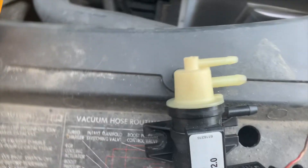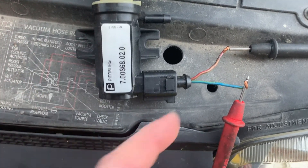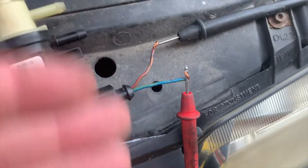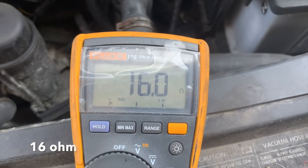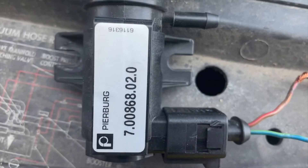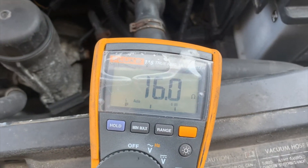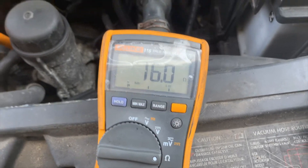If you want to test your N75, I'll show you how to ohm out the N75 valve itself. I'm going to grab a spare I have off the bench. This is a new one I bought when I was having an issue on my other car — I have a pigtail from it which makes this a little easier, but if you don't have one it's not a problem, you can just touch the pins inside. Hook them up — doesn't matter which side goes to which — come over to your meter, switch it to ohms. My meter is auto-ranging. That reading is from a known good new N75 with that part number for BEW. ALH might be slightly different, I'm not sure, but basically you want to make sure it's somewhere around there. If it's something crazy like 100 ohms it's probably got an issue, or even 50 maybe — you want it somewhere around that range.